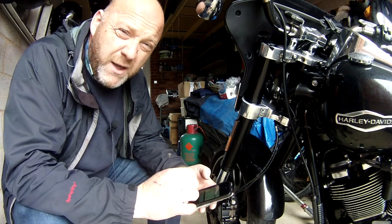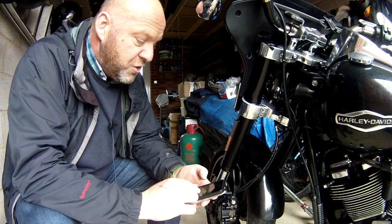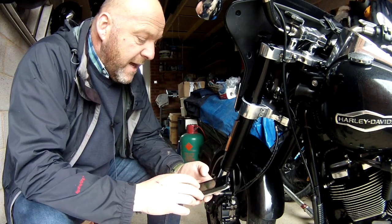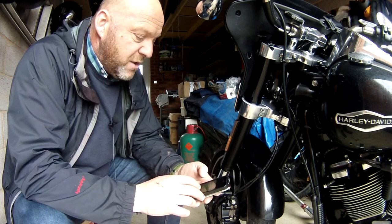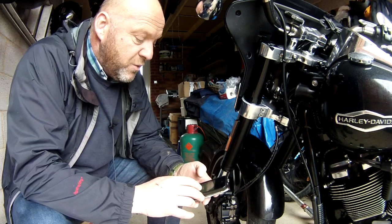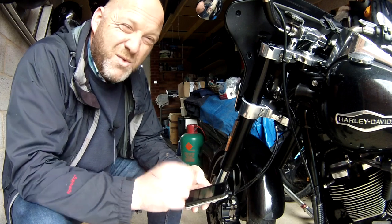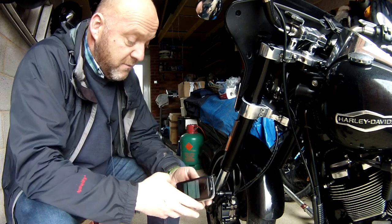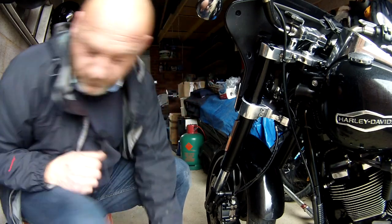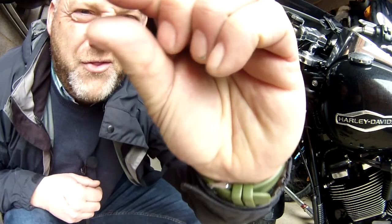The actual minimum thickness of the brake pads — the friction material, the actual pad itself — should be equal to or less than 1.02 millimetres, which is 0.04 inches. In other words, very, very thin. And what is one millimetre? Not much at all.